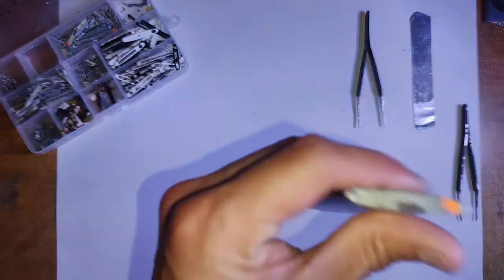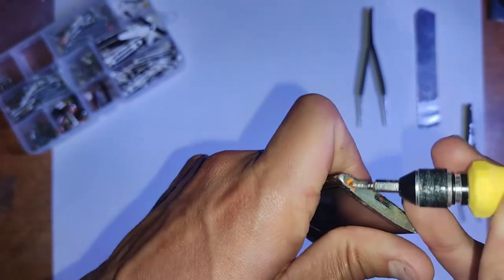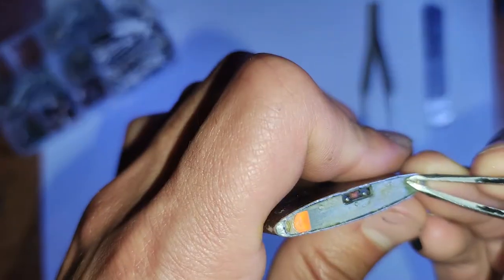You want to make sure you have an appropriate screwdriver for opening phones and iPods. You can't just use a big one and expect it to work. You'll just end up mashing up the screws. There's three at the bottom, two over that plastic shield piece, and then one over the headphone jack, and then two at the top as well.